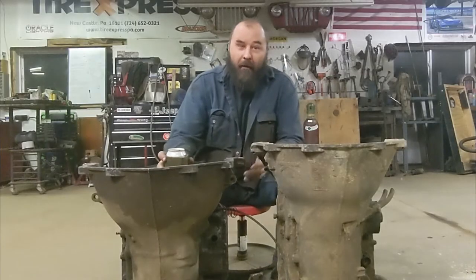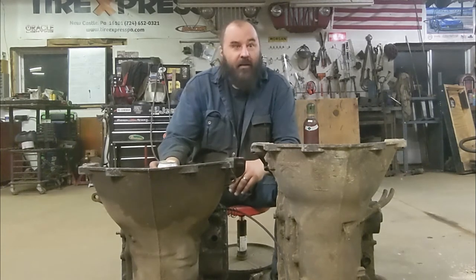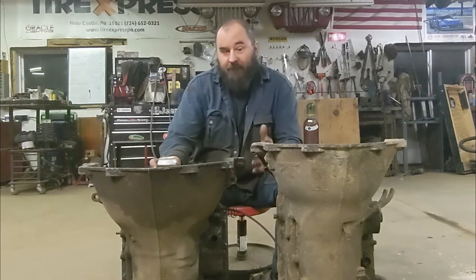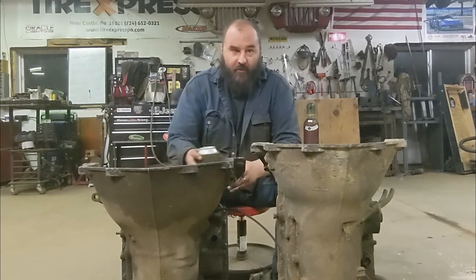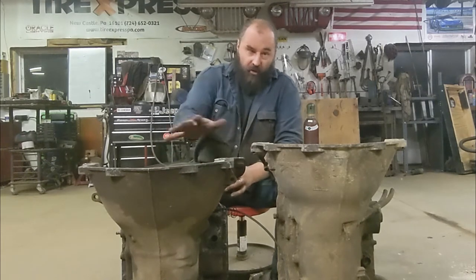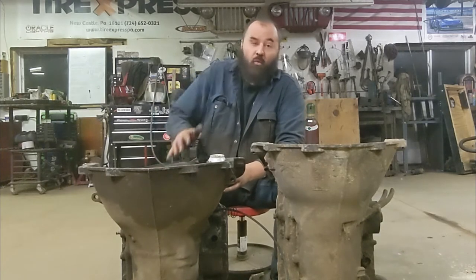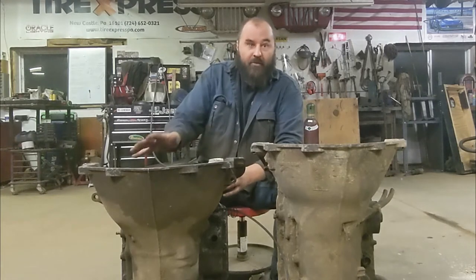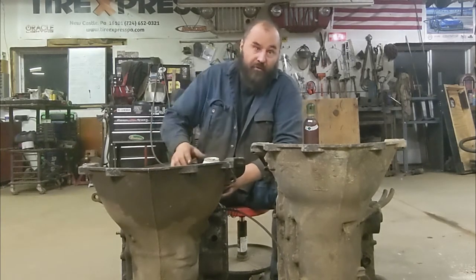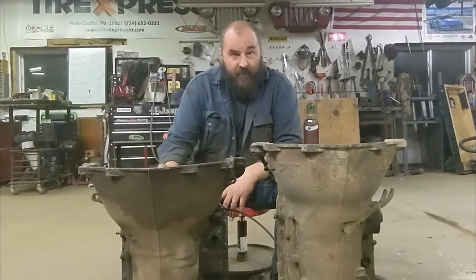You may wonder why we're taking parts from a 4L60E and putting them into a Turbo 350 transmission. A couple of reasons. One is length. You can see obviously there's a length difference between the 4L60E and the Turbo 350. They're currently sitting on the exact same mounts. The output shaft on the Turbo 350 is shorter, so it wouldn't work on that mount. With the proper mount between the transmission and transfer case, the difference is closer to 5 inches. So that's a huge reason when you're dealing with a YJ. Driveshaft length is a big factor.